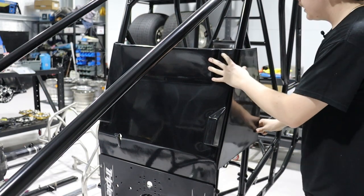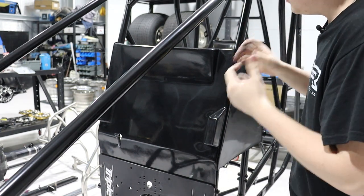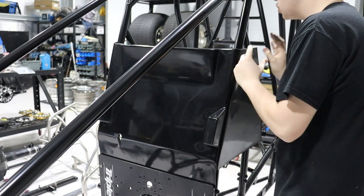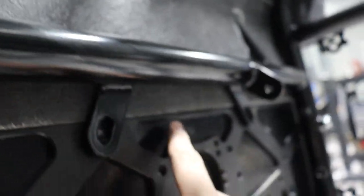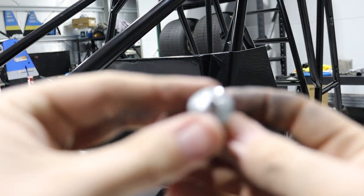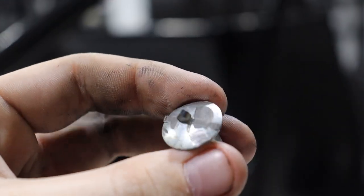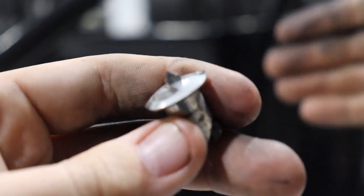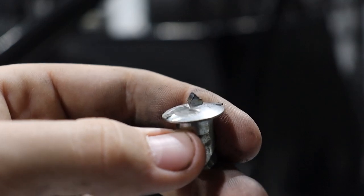Now I've got to get the holes marked up for the Zeus clips — there are about seven or eight Zeus clip holes that have to be drilled so the Zeus clips can mount the dash solid to the chassis. The guys at XXX made this really simple by creating a lip here, so you're not going to mount the dash any lower than it needs to be. What I made for this car is this kind of pointy little Zeus clip. What I'll do is sit this behind the body and tap on the body — it'll make a little dent into the fiberglass, which tells me exactly where I've got to drill the hole.